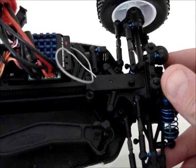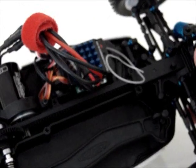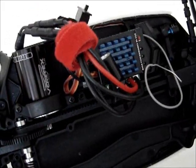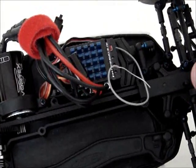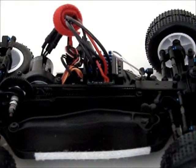I'm going to do what I can to rebuild and reshim this now, and then I'm going to give it a little run around the floor and we'll see what kind of temperatures we get, because last night as it was, the ESC, nice little Orion Vortex system combo there, that's 7,500 kV. The ESC thermaled, and I had to stop after 2 minutes of 5 miles an hour.